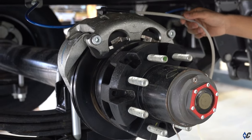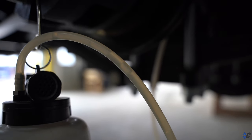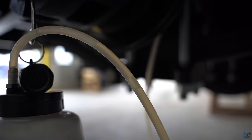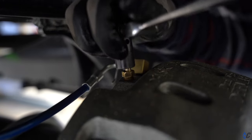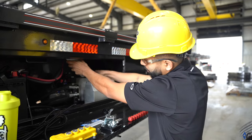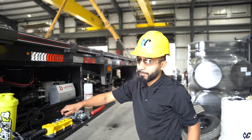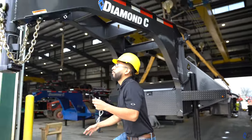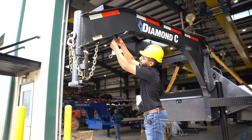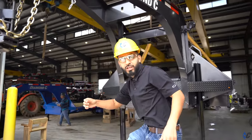What we're looking for here is air bubbles traveling through the line. Eventually you'll start to see straight brake fluid — once you see that, come and close your valve to ensure you do not spill any fluid and to confirm the system is properly bled. Then close your autofill, close your pump, and the last step is to put your pin back in your breakaway. We're all done — thank you for watching and stay tuned.